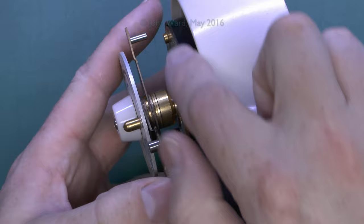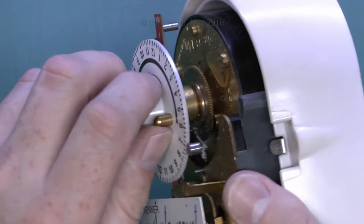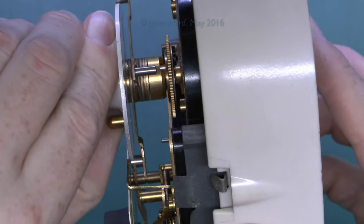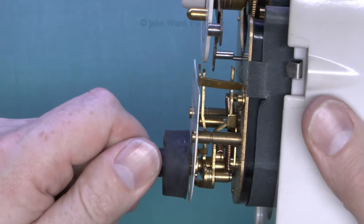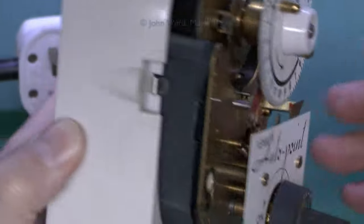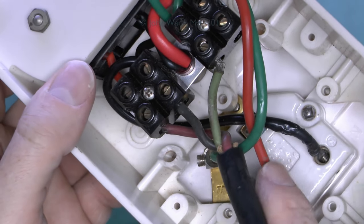The switching is pretty much the same - you've got the pins which stick out in one direction for on and then stick up in the other direction for off. Again as the dial rotates, the pins basically act against the lever at the bottom to switch the thing on and off. Again that's the same levers controlled by the turning knob on the front there to switch the thing on and off. This is a 24 hour dial so you've got your day and night there - it's one revolution per 24 hours. Construction-wise this is very similar, and it's actually screwed in the case with these screws on the back. Again you just have that single contact in the back which basically just switches on and off the socket outlet via these two wires on the back here.